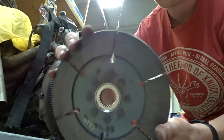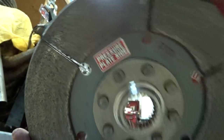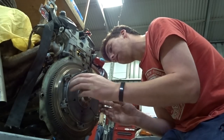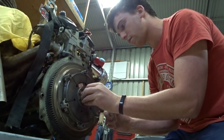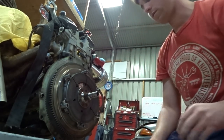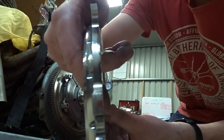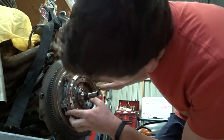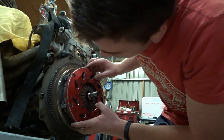Then there's the next plate, which has a sticker as well saying 'pressure plate' — that one's obviously sitting out. You can always just double check to make sure nothing's hitting. Then the next plate, because this is a twin plate clutch — there's the marking so that one goes down. And then last but not least the pressure plate, and that will sit in like that.